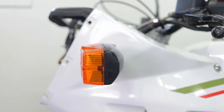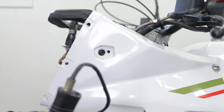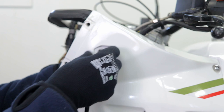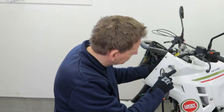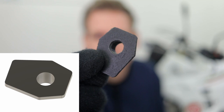I've already loosened the screws so I can just take it out. Here you can see the next problem — these indicators are specifically designed for this bike. These profiles fit exactly into this cutout. My new indicators, even though I can put them on here, it's not very pretty because they're too small and this whole cutout doesn't fit at all. In these situations it's very handy to have a 3D printer. I took measurements of the original indicator and made an adapter like this — it now fits perfectly into this hole.